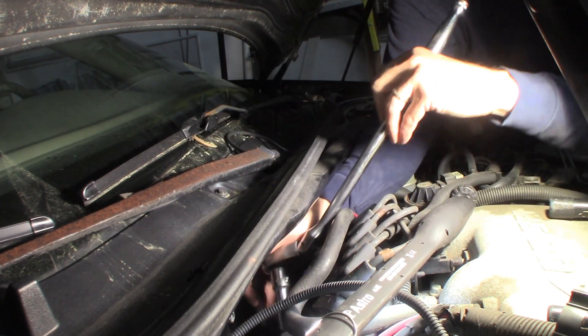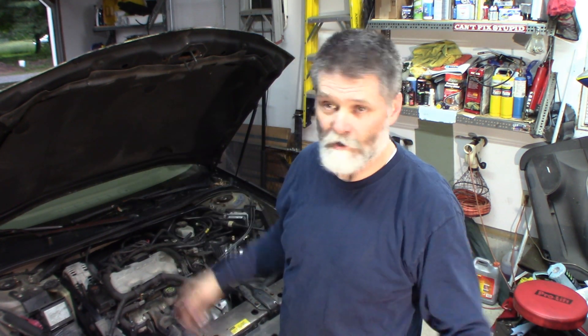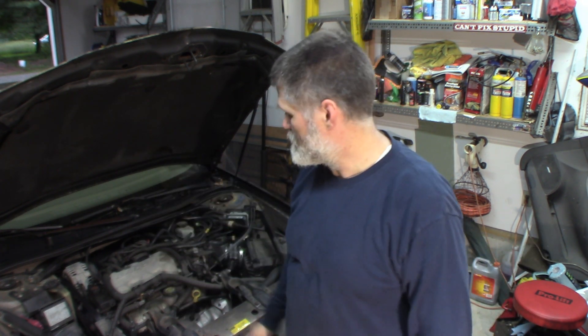Alright, that's it. After I took it out the heater circuit was open — meaning there was an open in the heater circuit. On the new one it was about 15 to 15.5 ohms, which is about what I'd expect. Put the new one in — didn't give us too much problem getting out. Sometimes these can be an absolute bear; sometimes you've got to heat them with a torch. But this one came right out. New one's in, plugged back in, and that's it — pretty simple job. P0135: test, don't guess. We were able to test this O2 sensor and immediately see the heater circuit was open, which is pretty common. If the heater circuit's open, it's no good — you need a new sensor. Hope it helps. If you like the video, subscribe below. Thanks for watching.